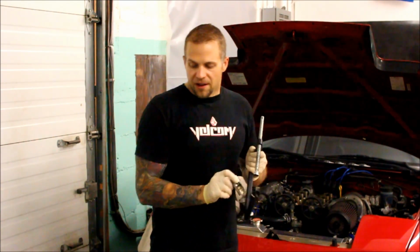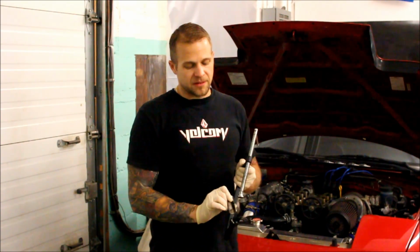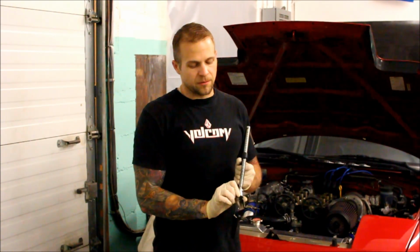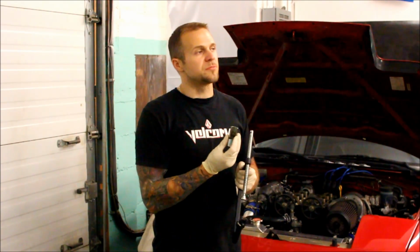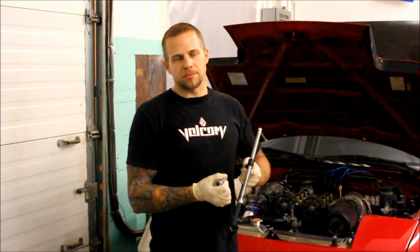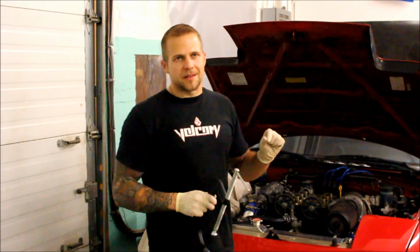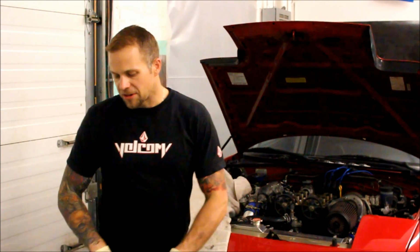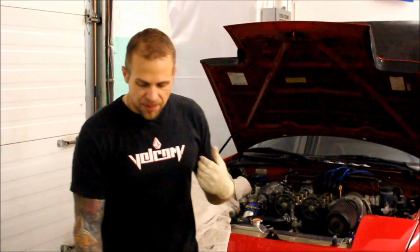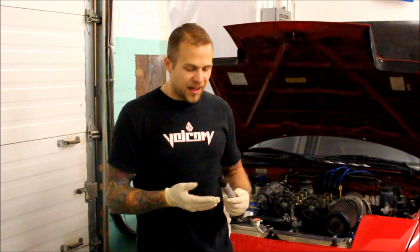So having the castings is a real pain because it does get in the way when you're trying to work in there, and that's why I cut such a big hole in the socket. Anything small on a traditional valve seal that will, say, mount to the castings on the head, the window's not big enough to really get in there with tweezers or anything to get them lined up nice. So this method, I picked up these tools from Summit Racing, and I've not used them before.